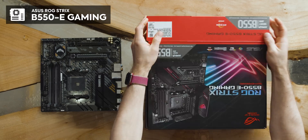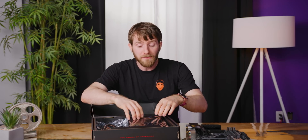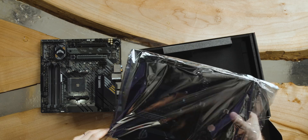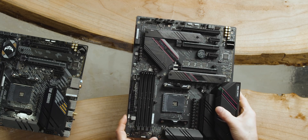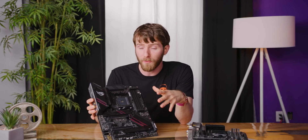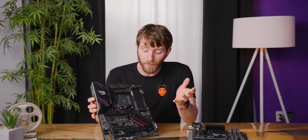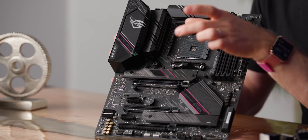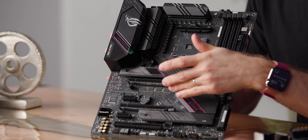To illustrate the next big feature, I need a different board. This is the ROG Strix B550E Gaming — because it's for gamers. This board has official support not just for AMD Crossfire but also Nvidia SLI, which we haven't seen before on AMD's mainstream Ryzen chipsets. Nvidia requires for SLI certification that the 16X slot can be split into 8X/8X, rather than having a 16X and a 4X, or an 8X and a 4X, as AMD allows for Crossfire support.